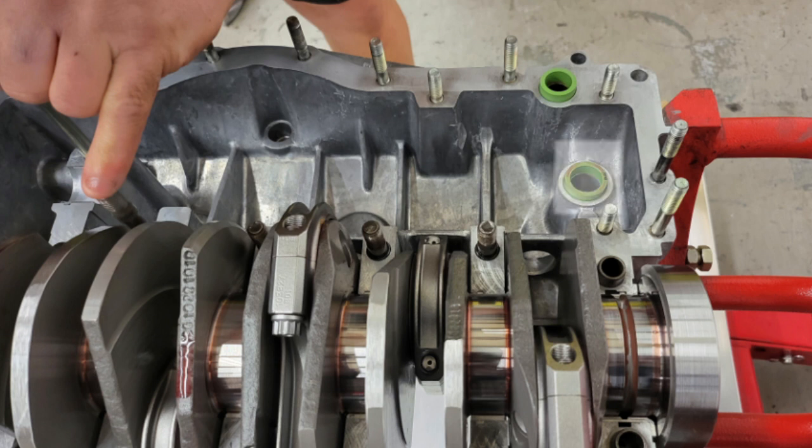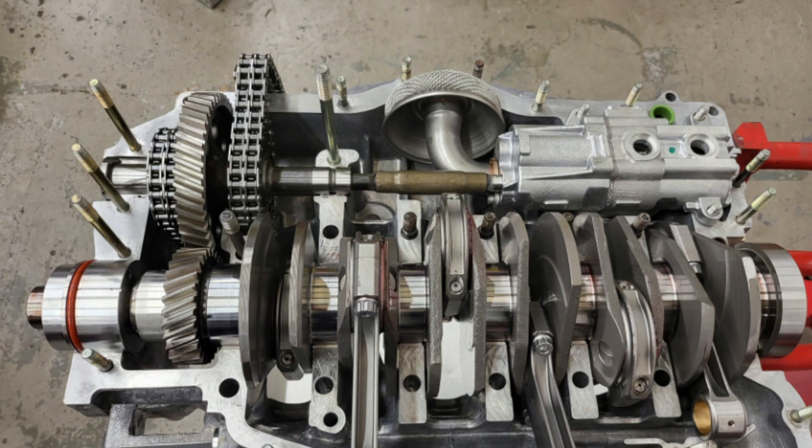There are four through bolts which have o-rings on them that have to be fitted. These are pushed through and the o-rings fitted using the conical tool, then dropped back into place. You can see that the bolts hold themselves in due to the shape of the end of the bolt.